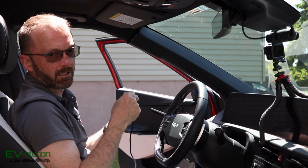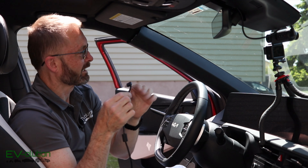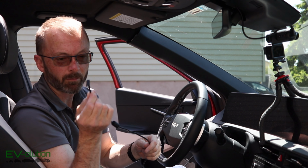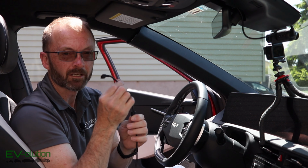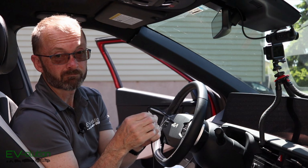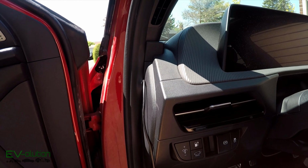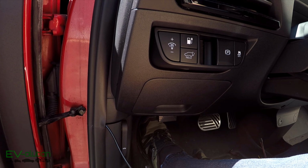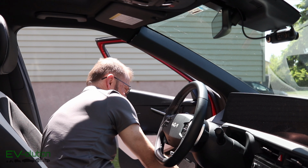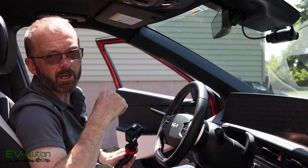Okay, that was no fun. Because this is shaped in a 90-degree, it can get hooked on a wire or plastic back there, so you want to be very careful as you run it through to not hook or pull anything, because that's airbag stuff. Next thing that I did was run it up this rubber right here all the way down to this joint here. So it's quite easy to take out. And now it's tie wrapped all up underneath there, so I'm going to go snip some tie wraps off camera.